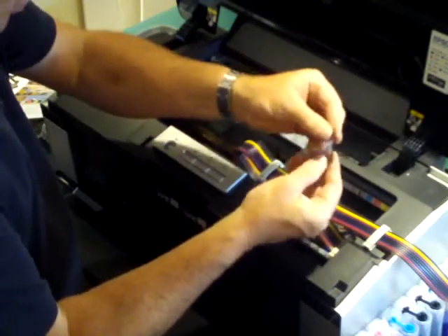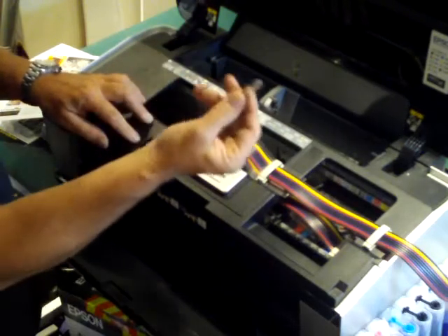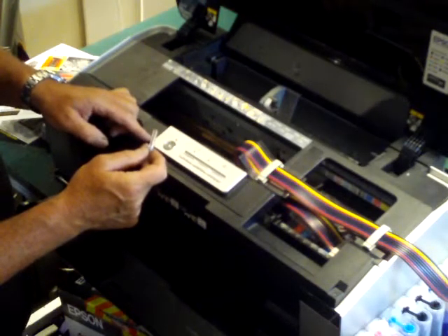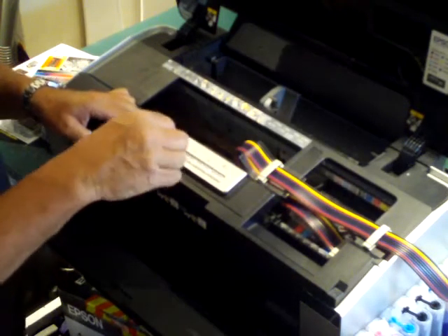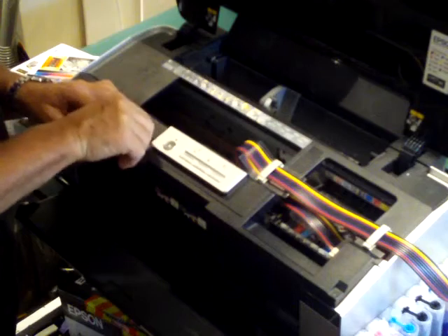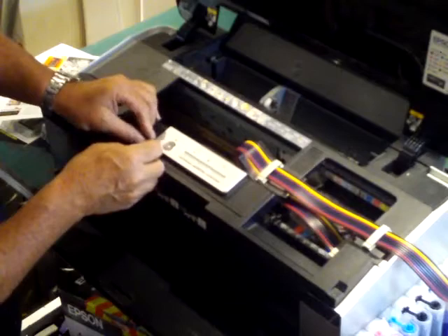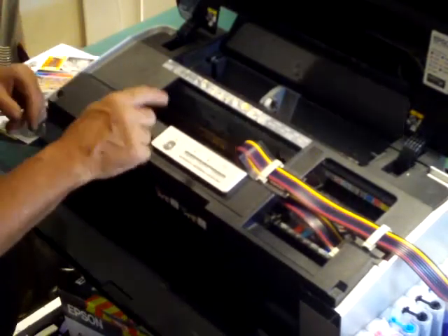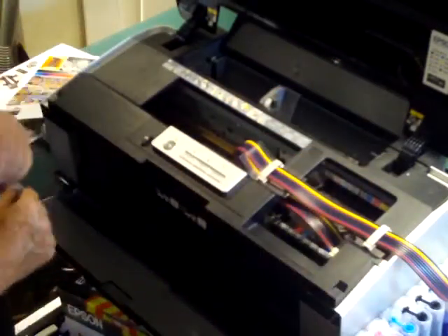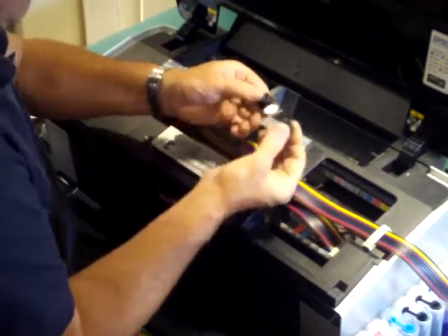What we now have to do is put this bit of tubing over the side here. There's a little slot and you can put this tubing into it. There's a little bar at the back of the slot, and the intention is to move the bar towards the back of the printer with this little bit of tubing so that the printer thinks that the lid is on all the time. It's a bit of high technology but it works like a dream — nice and reliable, telling the printer that the lid is down effectively.